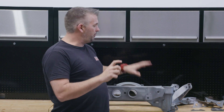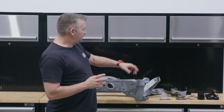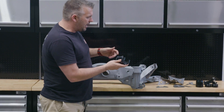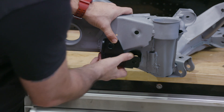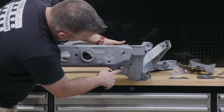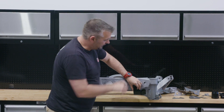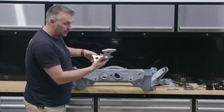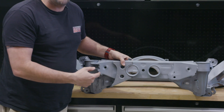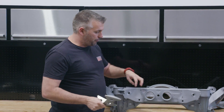So we're going to custom make a new pickup point for the front lower control arm. To reinforce it, we've got the GK Tech reinforcement kit for the rear subframe. However, this is designed for all Skyline and Silvia, but it's a little different on GTR as they normally have the HICAS there that you remove. If you want to put something like a HICAS removal bracket, you can't use all of the GK Tech reinforcement. One bolt goes through where the old HICAS system used to bolt up to, the other bolt lines up with the bolt hole that's already on the subframe, and basically that becomes the new point where your tie rod at the back links up to. Not all of the reinforcement bits can be used — this bit that normally gets welded here for reinforcement won't allow fitment of our HICAS removal kit, so we'll do our own welds and our own reinforcement there.